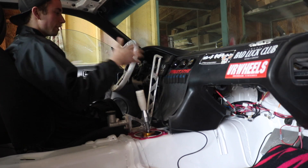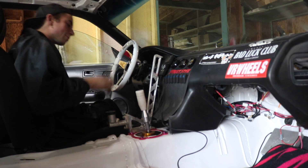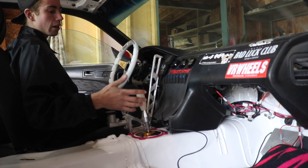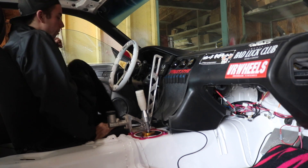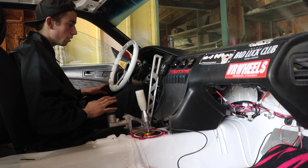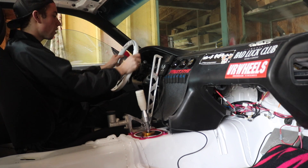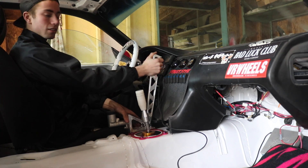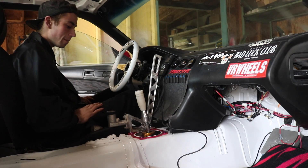Personally, I like my Hydro to be on the left side. I just feel it's more in the driver's position — it's easier to grab. You can see it; you're not winging it over here when you're running mad tandem. So we're going to be mounting my Hydro E-brake on the left side of a left-hand drive vehicle. If it was a right-hand drive vehicle, it would be on the right side for your left hand to grab. Make sure your seating position is good — your clutch, you're pushing in, you have a little bit of bend in your knee. When you mount your Hydro, that should be the actual position you're going to be driving in. Nice good elbow bend, good wrist bend — you can still bang hella gears. That is where we're going to be mounting my Hydro E-brake.